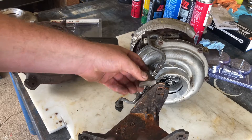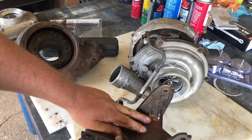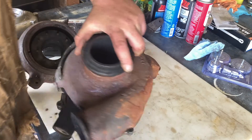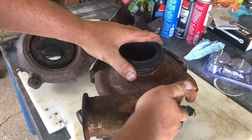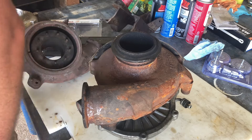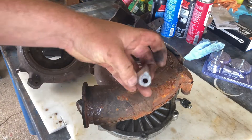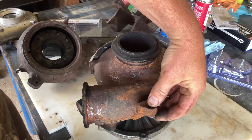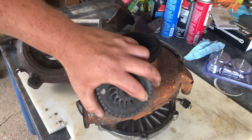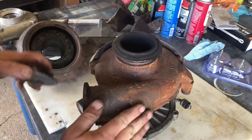So I guess there would be two ways to do this: you could cut the back pedestal piece off, which I opted not to do, or you can take the back tang off the back of the turbo here. You can see it's kind of already a little bit rusted out from where I did it. I polished it all up with a sanding disc and cut it with a zip disc. I used one of these after I had cut it vertically, cut it through, took it off, and then polished it down, trying to follow the case curve in order to fit onto the pedestal.